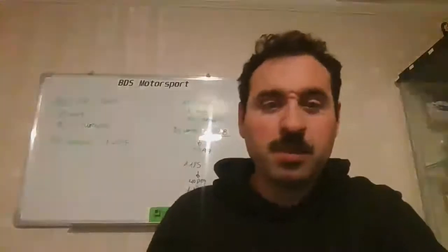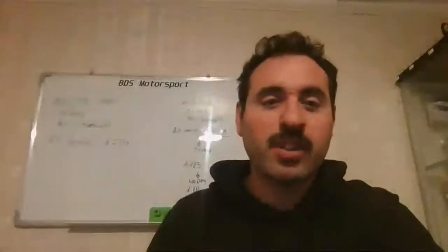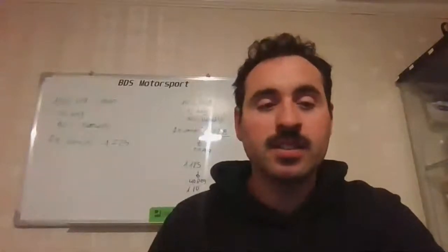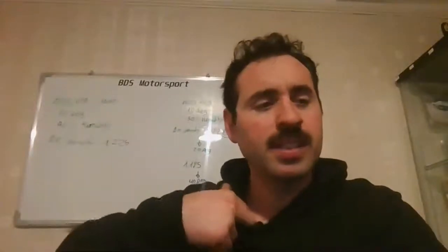Like recently, most dyno tunes I've been doing have been at between 80 to 90%, so it's very humid. It's not good, but the loss of density becomes worse with temperature. So when it's hot, the hotter it is, the less dense it becomes. So behind me on the board, I've written a few numbers. Now the impact this is going to have is quite big.